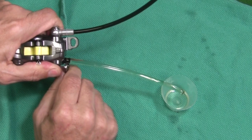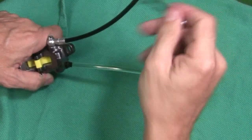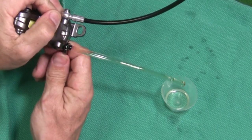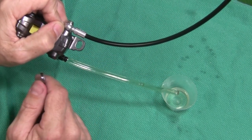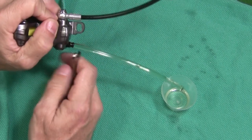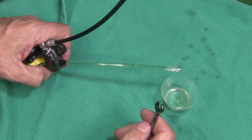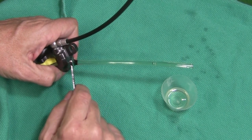I'm going to shut this off again, squeeze that down, and tap the hose and tap the caliper. I'm going to release it one more time and let a little bit of fluid drop out. I'm not getting any air bubbles here, so that's good. I'm going to shut it off again. Now we're going to go back up to the bleed funnel and put a rubber band on the lever so we can apply a little compression on the lever as we release and tighten the bleed nipple to make sure there's no air bubbles left in the system.